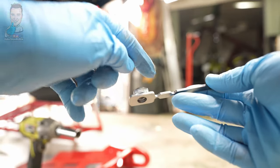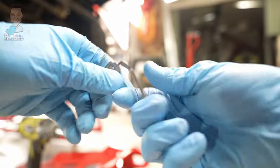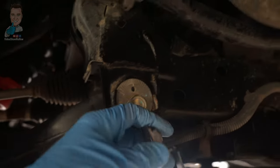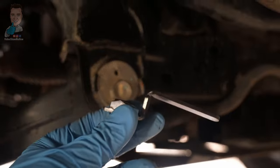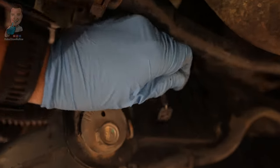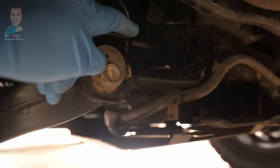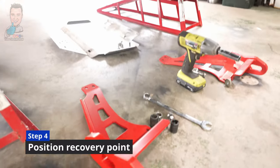Once the bash plate is off, grab the little stick nut and bend it to shape — you want a bit of a dog leg, a chicane going on. Bring your strong hands for that. Once it's bent, bring it up underneath, find where your bottom control arm is, and you'll see the big connecting bolt and next to it a little hole. Slot the stick nut in there so it sits down facing the front, with its tail hanging out. That tail will connect via a bolt hole at the front when we bolt the recovery point to the chassis.